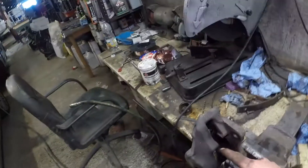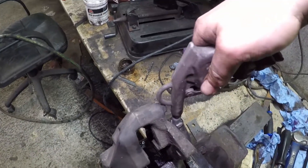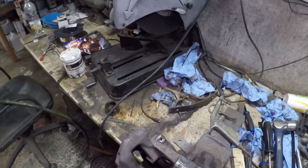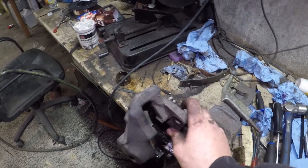I sometimes wonder why I take on these jobs. So I've got that piston out on that side — in the end I used the old trick with the air line. A bit of rubber on the end of the blow gun, stuffed down in there, and pumped 150 psi in. That will help shift the piston if it's really stuck because it normally does the job. But if both pistons are equally stuck you're only going to get one out that way. I was planning on holding one back in and locking it so I could work on the other one, but it didn't work — it just exploded out anyway.